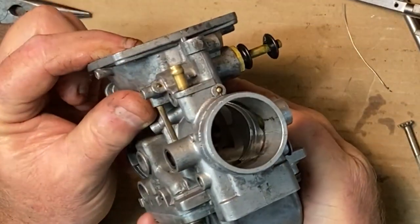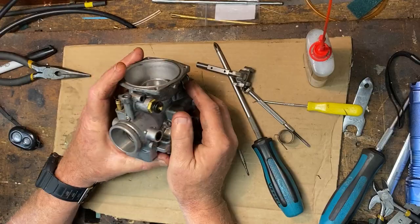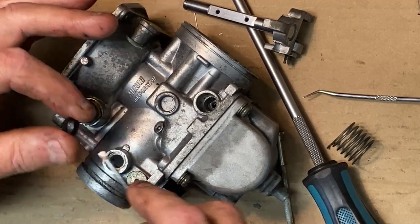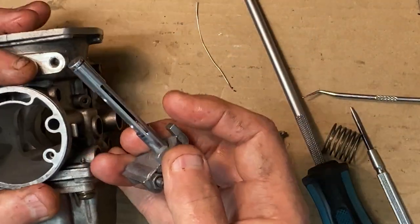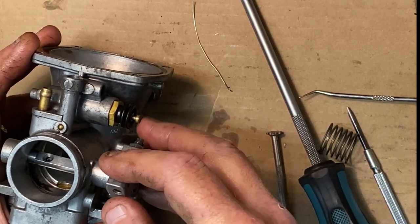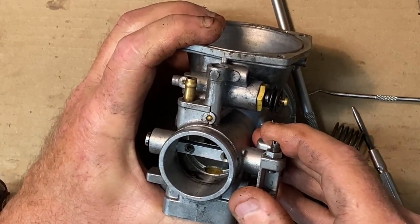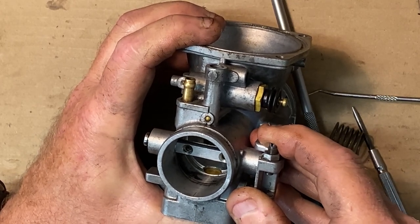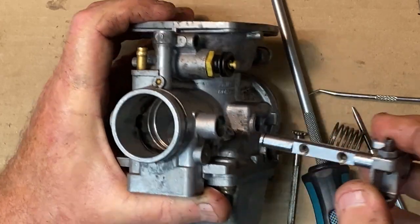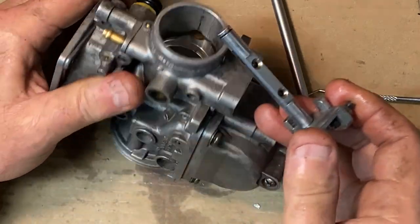The bore doesn't look so bad. I think those bushing materials are brass or bronze — I'm not sure. Now I want to pop the seals out — they come right out. Now that we don't have any spring tension on it, I want to put it back in, try the other side, and really get a good evaluation of how much wear is on here. It just doesn't feel like that much — I could set up a jig with an indicator to measure it, but I think it's pointless. It might be two thou of movement — maybe a thou and a half. Comparing side to side, these are in fine shape. I would say that if this was a problem, our seals were the culprit.